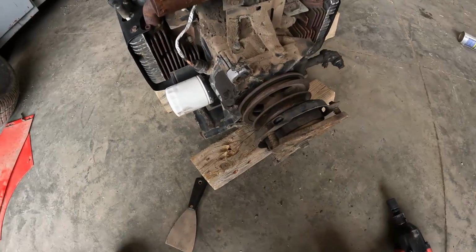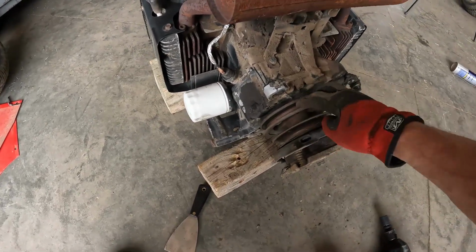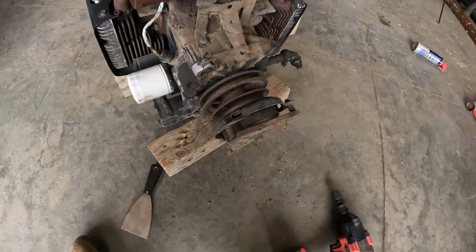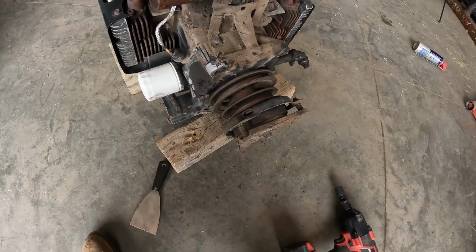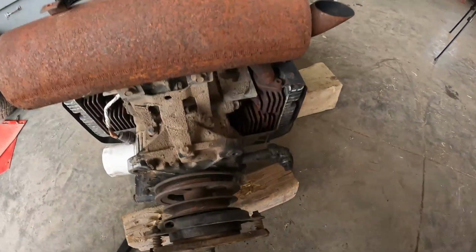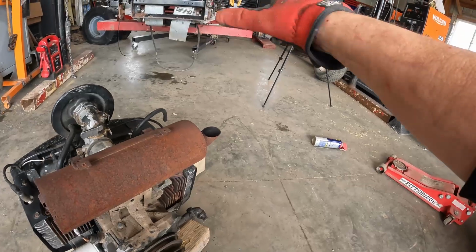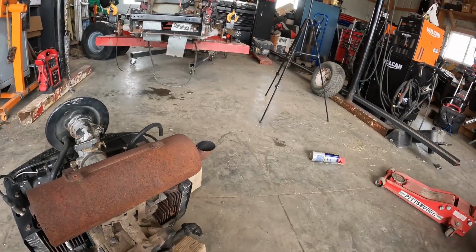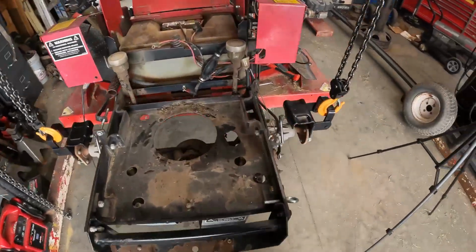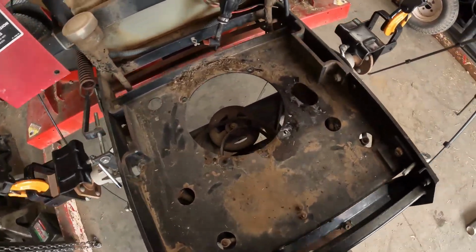So yeah, I'm gonna have to get my puller, and I've got some big ones, and get onto this pulley here inside of there, and I'm gonna have to pull this off. And unfortunately, they're in a toolbox stored away. So other things I'm going to do, and one reason I've got it sit on its side is so the oil moves. I need to switch this oil drain over to that one. The drain's pretty much in the same spot, but it's straight. So definitely going to be doing that. But I can at least clean this all up and get the grime off of it.